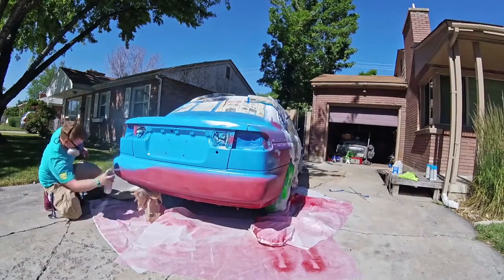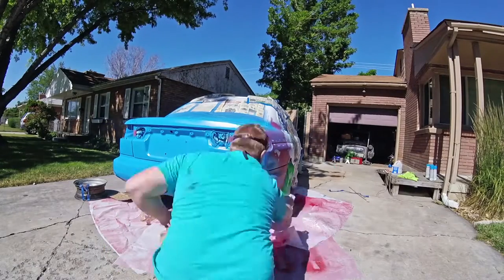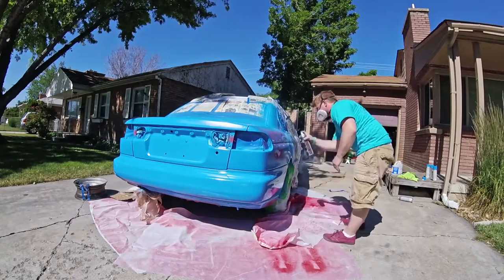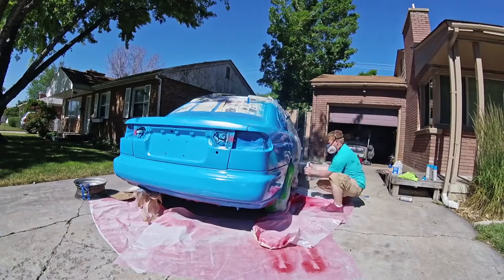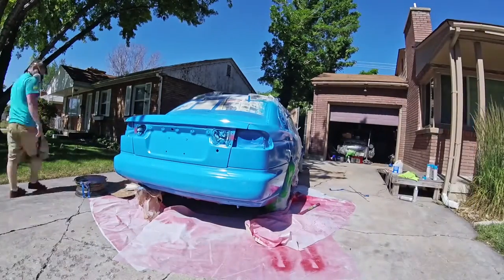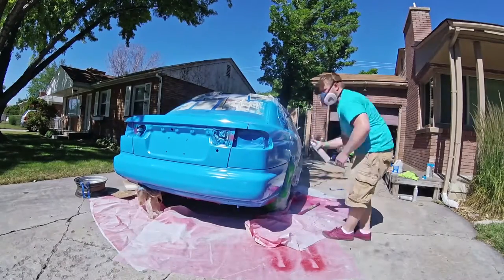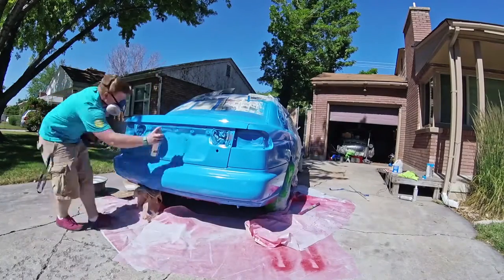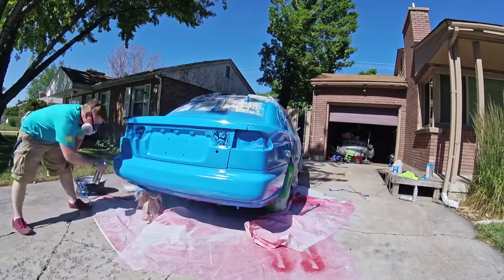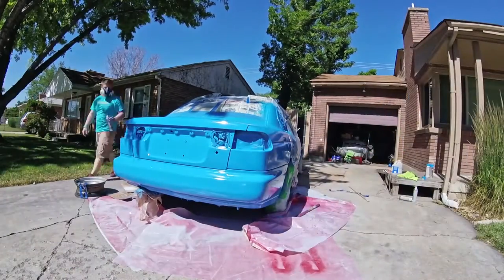This can be really difficult when working with a full-gloss paint like this Rust-Oleum blue. As you color different panels it's extremely difficult to keep a consistent wet line across the whole car. Plan your route before you spray — the best way is to work from one corner, say the driver's side front, all the way around to the rear and back to the front passenger side in one coat. It was really hard for me since I was painting in direct sunlight on a very hot day, which made the paint flash extremely fast. The best time to spray-paint large areas is on an overcast day in about the 70s — any hotter or in direct sunlight it's really hard to keep a consistent sheen. I knew I probably wouldn't get those conditions for the rest of the summer here in Utah, so I decided to do my best and deal with the outcome.